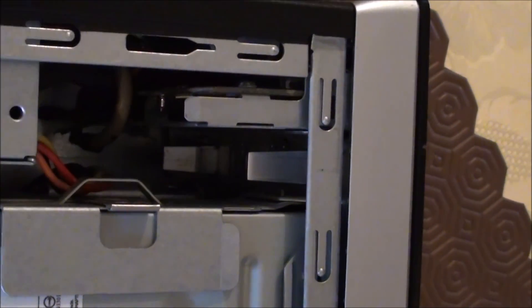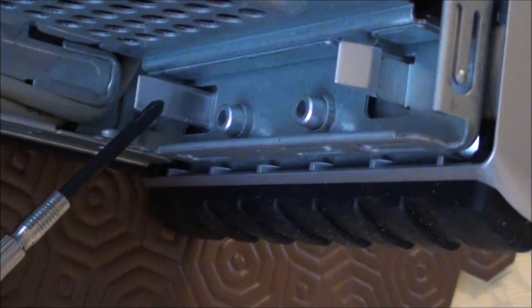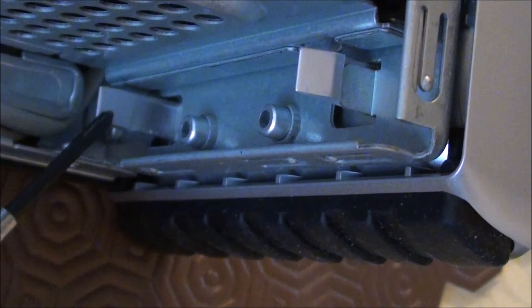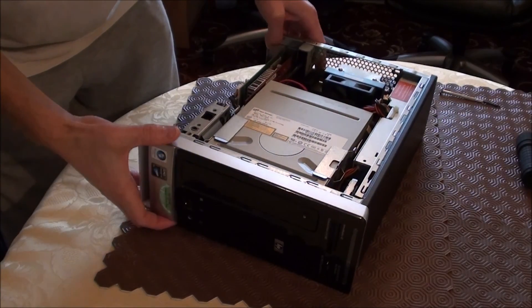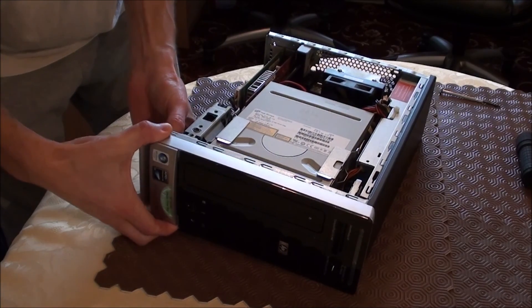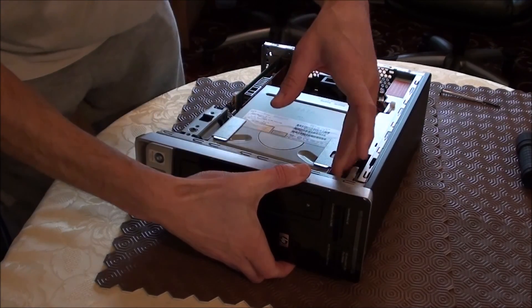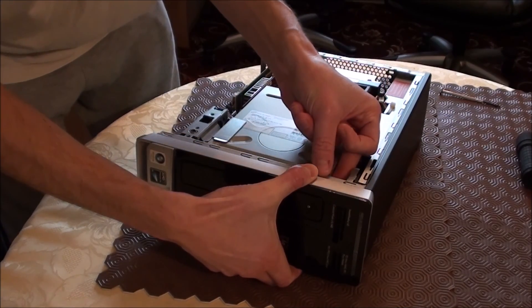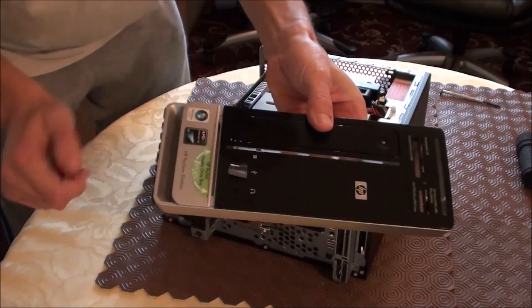You've got to give the bottom clip a gentle push away from you, and give the top one a gentle pull towards you. As you do that, the front panel will just sort of ease forward. Same with the bottom ones — except this is the bottom of the fascia panel. Unlike the top one, you've got to pull the bottom one towards you a little bit, and this one you push away from you. I'm going to slowly pull the front away now, starting with the bottom. The front's come away about a quarter of an inch. Now to the top — just get my finger down inside, push that bottom clip clear. I just felt it release. Pull the top one towards me. You've got to remember to be gentle — you don't want to snap the clips off. And there's the front panel.